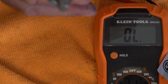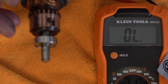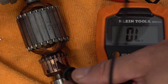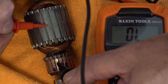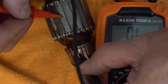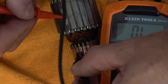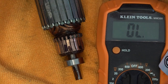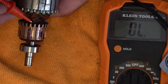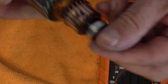If you're getting major spikes, it could be broken or burnt-through wires anywhere in the windings. There is one more test — there should be no continuity between a bar and the shaft. So what we've got is broken wires somewhere in the armature, and to repair that I might as well just get a new one and put it in.